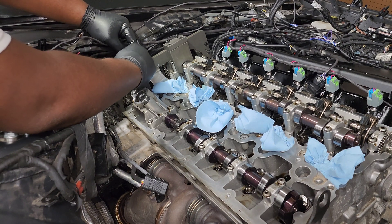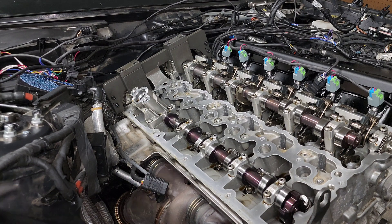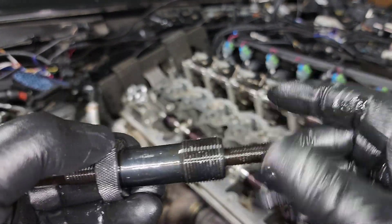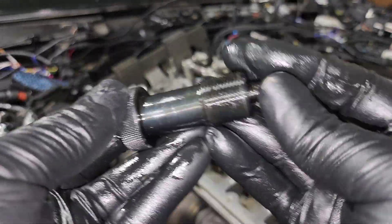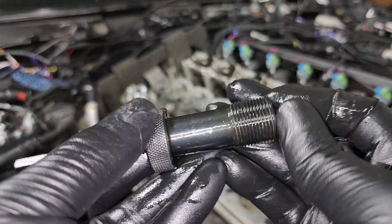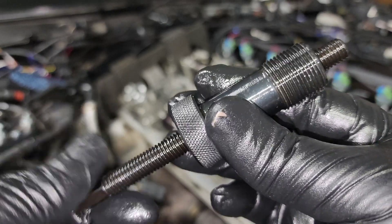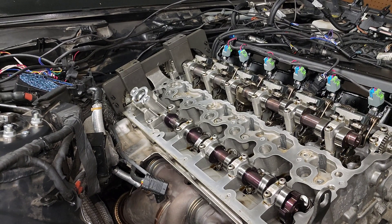Remove the cam lock from the intake and exhaust side. This chain tensioner tool is really useful — I didn't use it initially, I just used the OEM tensioner. But the problem with the stock chain tensioner is it really needs oil pressure to keep the chain under tension, which obviously you don't have when the car is off. So this fake tensioner tool is a lifesaver. You hand-thread in the main part that matches the thread pitch on your tensioner bolt, and once that's hand tight, you screw in the thin part until it pushes the timing chain guide in place and holds your chain in tension.